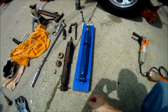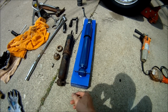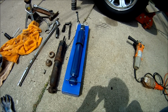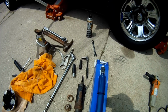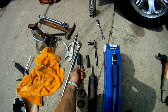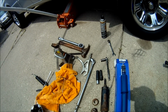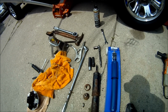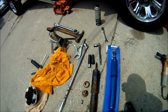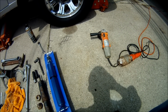And then there are 2 built-in bolts on the control arm with a nut that just screws onto the bottom to hold those bottom 2 in place. So that's how the layout's going to go. For tools, you're going to need a 13mm socket, and a 19mm to get the wheels off. I've got some vice grips, a torque wrench, a hammer, and a crowbar, because this is Michigan and all the bolts on this are going to be rusty, so I'm going to end up cutting most of them off with a cutoff wheel or an angle grinder.